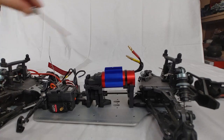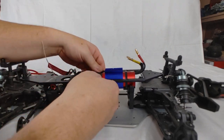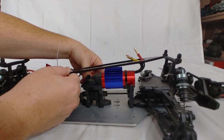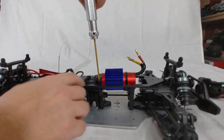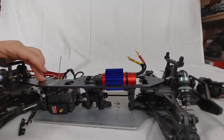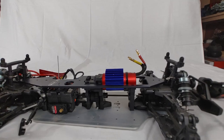Take those screws out, and I'd also recommend going ahead and taking out the rear and front screws just to get them out of the way, since we're going to need them out anyhow. Now these just lay right on there on both sides. I'm not going to make it completely tight yet because I want to make sure my holes align. I'm going to put the mount screws in next. I'll use some Loctite thread lock — just to keep them in there. These are aluminum, so just thread lock them to help them securely stay in; when you're bashing you don't want those screws to back out.